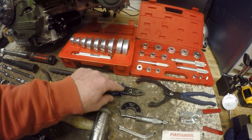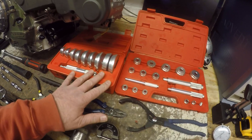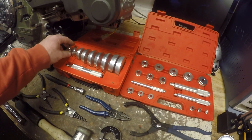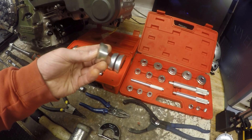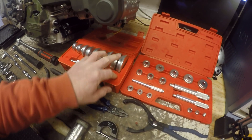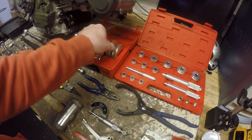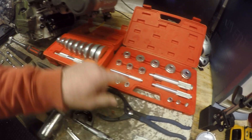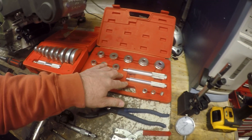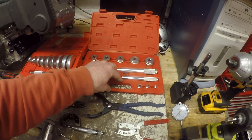General-purpose pliers so you can pick out little dowels if needed. Then two sets of bearing press dies for the various sizes — going all the way up to 81mm for the big ones, which copes with your main bearings — and a smaller set that copes with smaller bearings such as your gearbox bearings and the timing layshaft bearings.